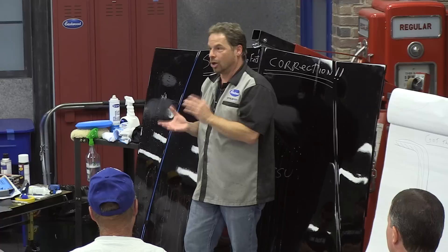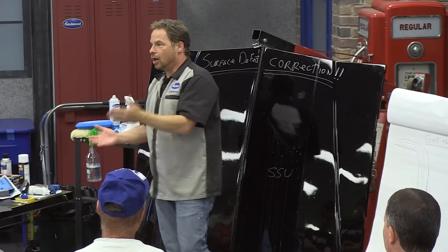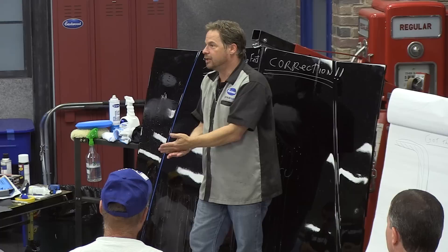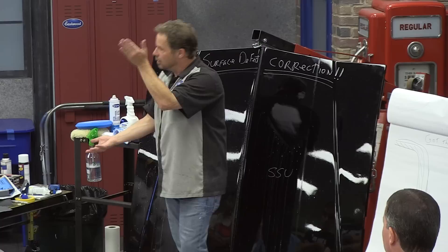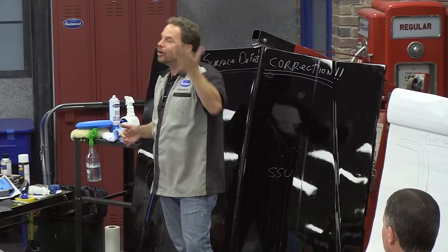I use Eastwood's high-build poly on it because it doesn't shrink — there's almost no solvent in it. It's truly spray filler. How many people use high-build polys? It's a beautiful tool. If you've never used a polyester surfacer, I urge you to try it — it's part of the shaping process, not even really priming. I built a car a couple of years ago called Jaded — a '66 Mustang Coupe. We went from bare metal up with all Eastwood stuff as an experiment with their new paint system. I have a theory: no bad paint, only uneducated painters. The car debuted at 2012 SEMA, was shot for Popular Hot Rodding — one of the 12 best cars at SEMA in PHR.